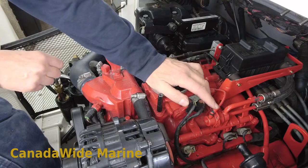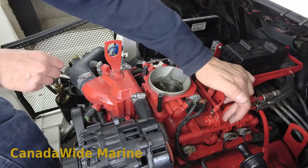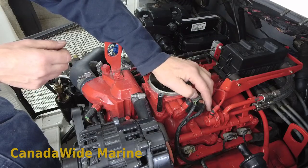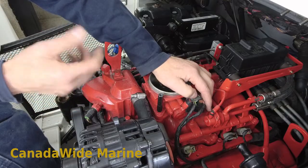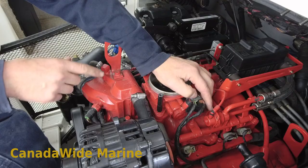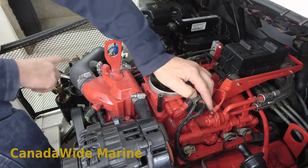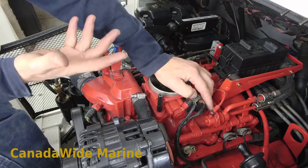This is a return-style fuel pressure regulator. The fuel comes from your fuel pump and then this regulator lowers the pressure down to the correct pressure for your fuel injectors. Inside this regulator is a little screen, and that screen gets blocked up with the black paint or any other dirt from within the fuel system. What that does is it doesn't allow the regulator to return enough fuel back to the fuel pump assembly.